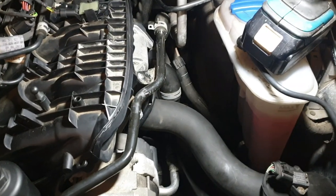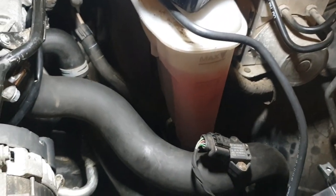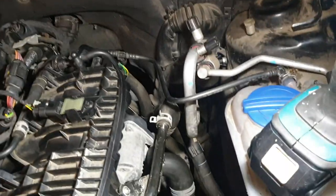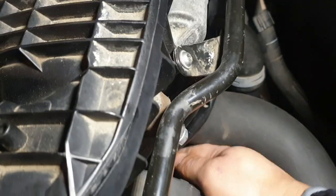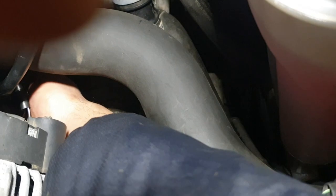So just want to update you on that coolant pump pipe. I've gone out for a drive, a good 45 minute drive, and there's nothing wrong. The auxiliary pump kicks in, all my heating's fine, no overheating, and I'm not getting that fault anymore with the coolant bypass valve control circuit open. And I put my hand down there, and there's no water, nothing, no leaks, no moisture.